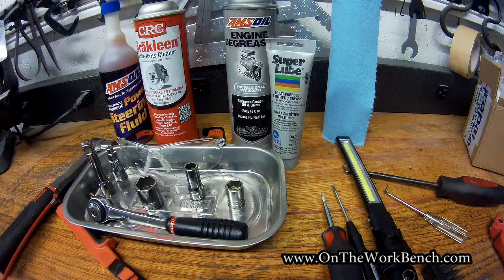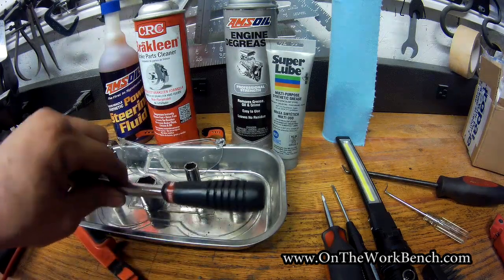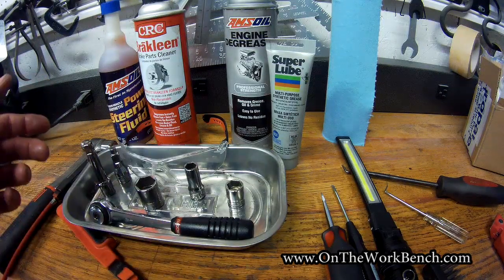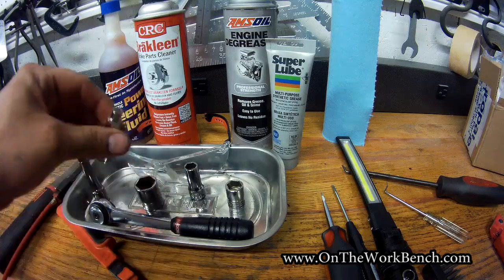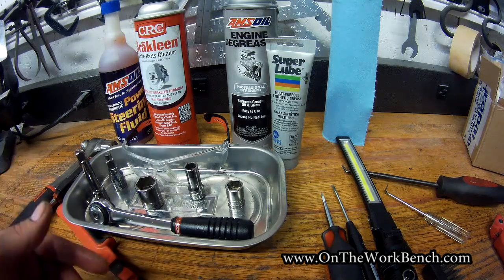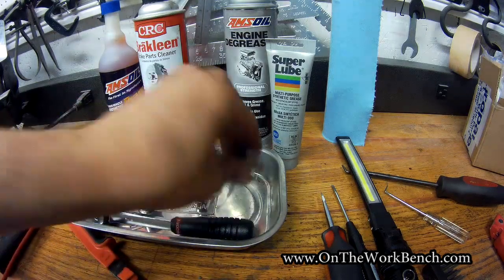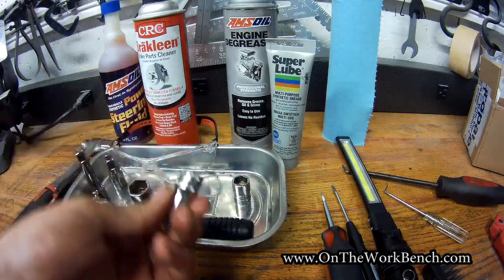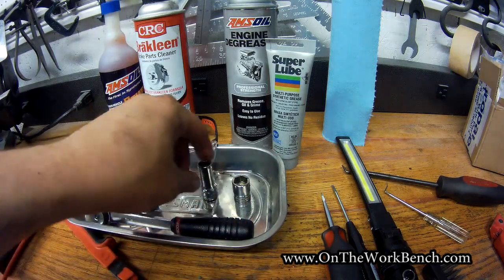Let's take a look at the tools we're going to need. I think they're just generally some pretty basic tools. You'll need a 3/8 ratchet — I'm going to use a stubbier one so I don't over torque some bolts — a 3-inch 3/8 extension, and a magnetic adapter. I've got a video about this on my channel to help fish in a couple bolts that will be invisible because they're going to be underneath either the vacuum pump or the power steering pump. We're going to need a 19-millimeter socket, a 13-millimeter socket, and a 10-millimeter socket. You could probably get away with a short socket with an extension.